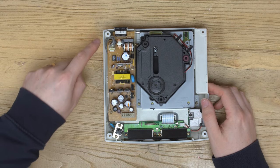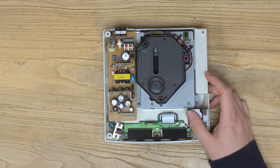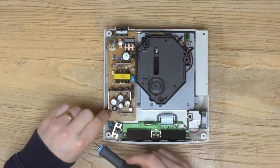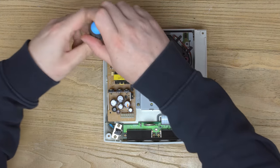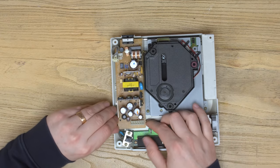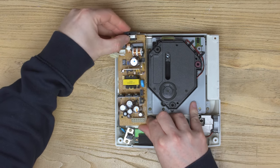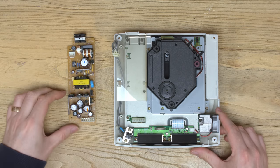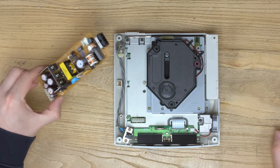Once inside, be very careful of the old power supply, especially the top area, because this can have mains voltage on for a good half an hour after unplugging the console. So leave it to sit for at least half an hour if this has been plugged in. Remove the two screws — or however many screws your particular variant of power board has — holding the board down. Some might have just clips. With that done, unplug the power switch and lift the power board out. It will still be held in by the physical pins at the bottom, so just give it a tug to remove. There's also a protective cover that stops the old power supply from shorting — this won't be needed for the Clean Power because it doesn't touch the base. Set all those parts aside.